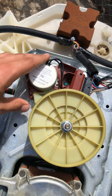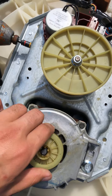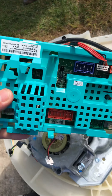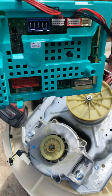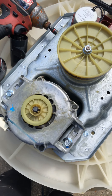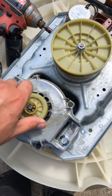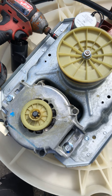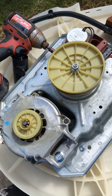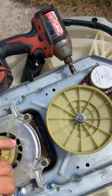The only other components I could change were the motor or the control panel timer. The control panel is $150 to $200, and the motor is around $170. If you're going to spend that much, you might as well just buy a new washing machine — if they're $400 to $600, find a good one on sale.